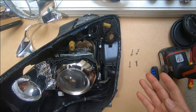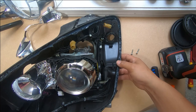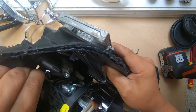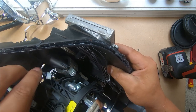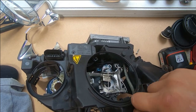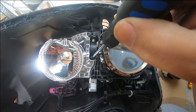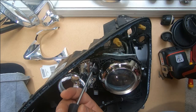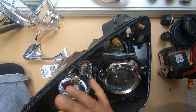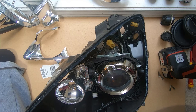With all that removed we now have access to a lot of the headlight. Make sure we unplug everything so once we pull it out we don't have to worry about wires getting caught. On the side right here there is a connection — pull on it and it will release. There are two tabs on it that lock it in place; just pull it down a bit and then pull it out. In order to remove the headlight we have two T20 Torx screws that we need to remove.